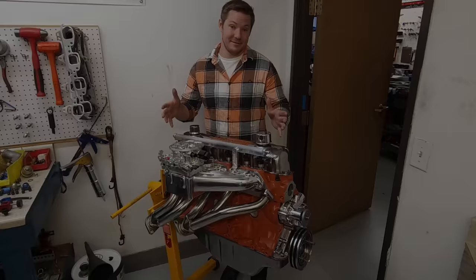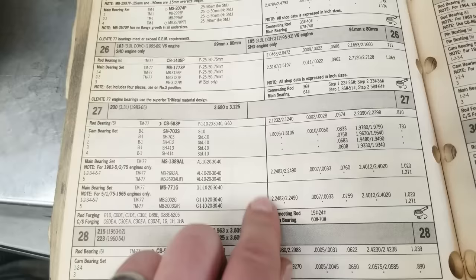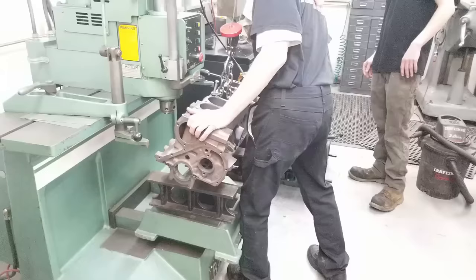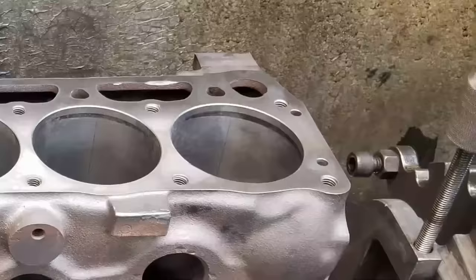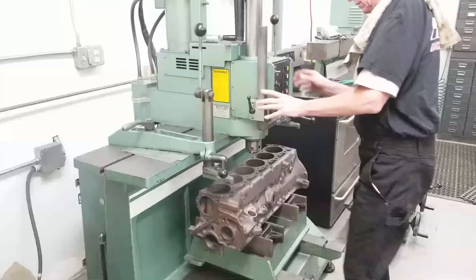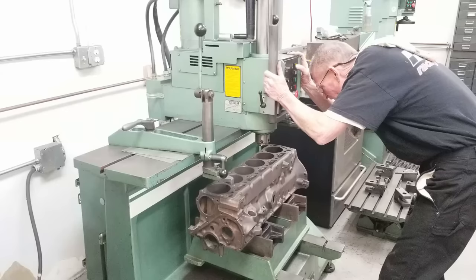One of the first things you are going to want to do is look up the bore specs for your motor. You can find these either in the maintenance manual or in a standard shop manual like we have here. Once we had that information, Rick loaded it onto the bore machine and then leveled it. As you can see here in the cylinder walls, we actually had some grooves that had formed from the pistons over time. Because of that, we had to bore a little extra out. We were originally planning to bore to 20 thousandths over and it eventually had to go to 25 in order to get those grooves out.